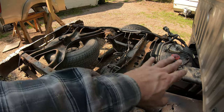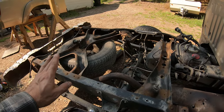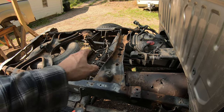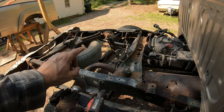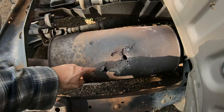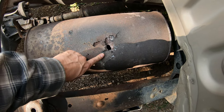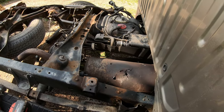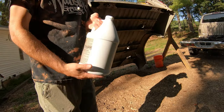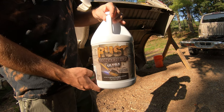We got the truck bed frame — at least this section — pretty well scrubbed. I'm not going for perfect, I'm going for better. I got most of it hit with some abrasion and knocked off all the loose stuff as best I can. Going to go in and hit it all with that rust converter everywhere I can see. We did find a new problem — the muffler is totally trashed on the top end, so we'll have to get that replaced. But while I've got the bed off, I might as well coat everything with the rust converter.